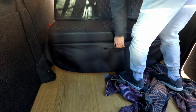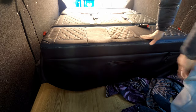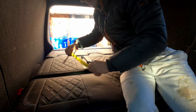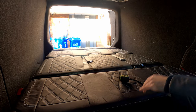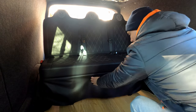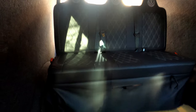And now I just wanted to unfold it and make a bed out of it, and take more measurements. Just make sure the bed is square, and I was happy with the position of the bed at this stage. And at this stage you might want to go and close your back doors and make sure we can close okay. And now I'm making a seat out of it. Because the bed is very heavy, it did move, but because we have these pencil marks around the frame, we can verify the bed didn't move, so I was happy with that.